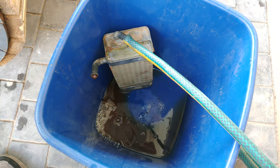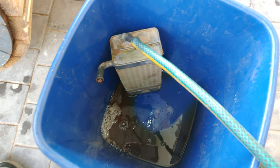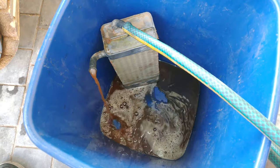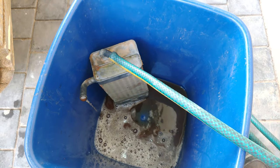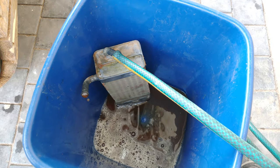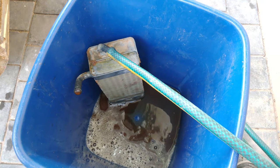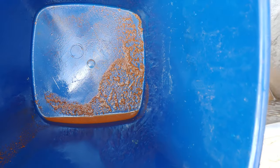I'm rinsing the little heater core — I've let it sit for a while in vinegar. Look at all this stuff that's coming out of there — that is absolutely gross. That's about 50 years worth of nastiness. It took me almost an hour to rinse out my Regal's heater core, so I'll be here a while. This is all the dirt and rust and crap that has accumulated in the heater core, and this is just the first flush. Remember to flush your heater core guys, especially if you haven't used it in a while.